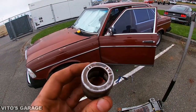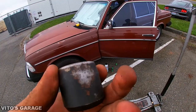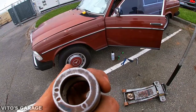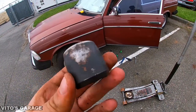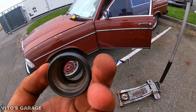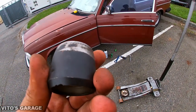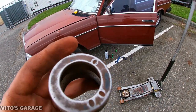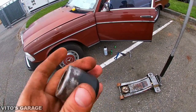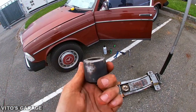Anyways, guys, so I have my metal piece that I was talking about, as you can see, it's all pretty much sanded down. What I'm gonna do now is just put it in vinegar for like 24 to 48 hours, and that's gonna eat the rest of the rust away, and we'll see how it comes out afterwards. I might have to do some more sanding, but the final product is gonna be actually really nice. I have some paint for it prepared as well, so it's gonna be awesome.